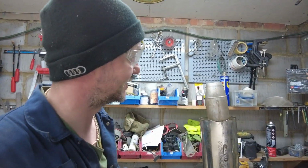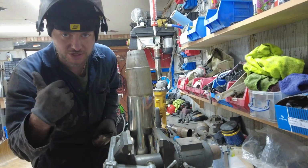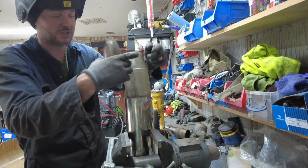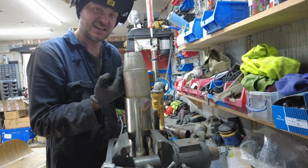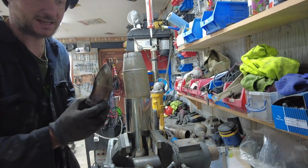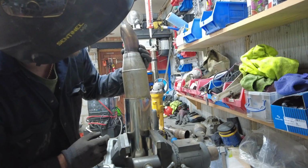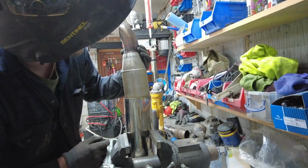If we have enough room, I might need to massage this a bit. Tacked in place, checked on the car, it clears. We have about 15 mil to the notch I made, so that's actually good. And I think the flat floor, even if it touches, it's fine because it's aluminium on this, it's not going to melt. The tip, I just measured it, so the tip will go like this. It's not the prettiest of things, but I reckon it will look alright once I'm done.